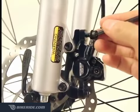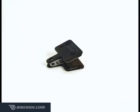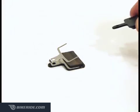The first step is to remove the disc brake caliper by loosening and removing the two bolts holding the caliper to the adapter. Now unscrew and remove the retainer bolt, and then gently push out the pads and holder using your Allen wrench.